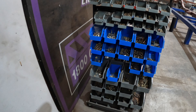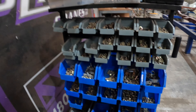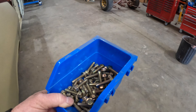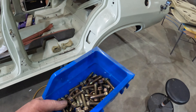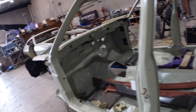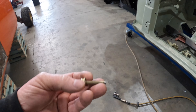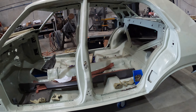A couple of years ago I was rebuilding one of my own cars and I decided to go ahead and get a whole bunch of bolts plated, and this is the result. It's turned out to be a pretty good collection. So we want hinge bolts. The only thing about these bolts is sometimes there ends up with a little bit too much plating on the tip. Sometimes they're okay, but sometimes I find I need to just round that end off a little bit - I think it's just a build-up of the cad plating. It makes it a little bit hard to start, but if you round that off they're fairly easy to get going.